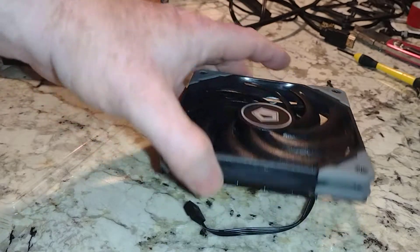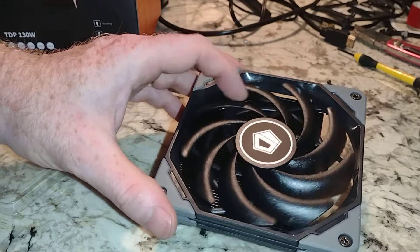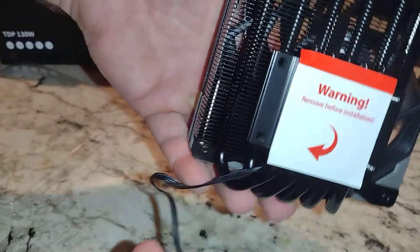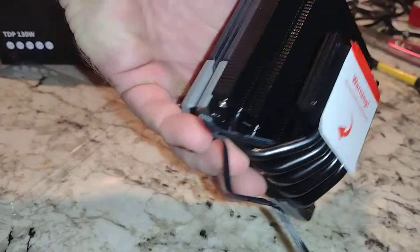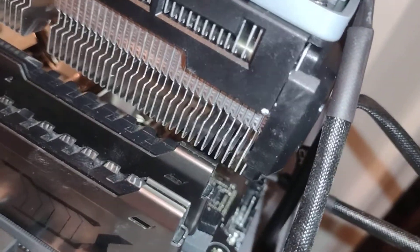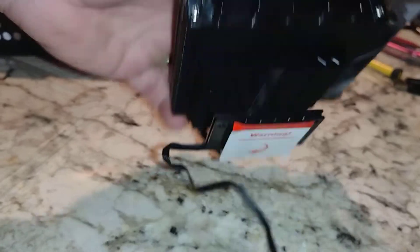This is going to be easy to install, I believe. You probably have to go through the fan blades to get to the brackets. You'll take this piece of tape off here — you probably want to clean it after because these have a sticky residue. Not much of a heat sink here, so I can see why the TDP for this is less than the Thermaltake. Now the fins are a lot closer than the Thermaltake's. If we check out the Thermaltake, these are much denser — whether that's such a good thing or not is another story.